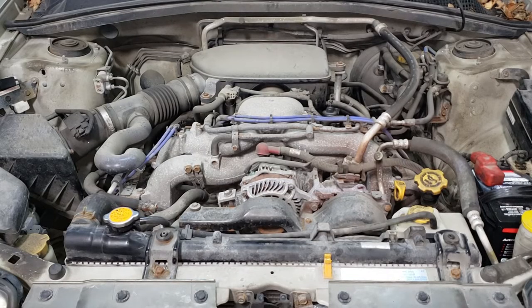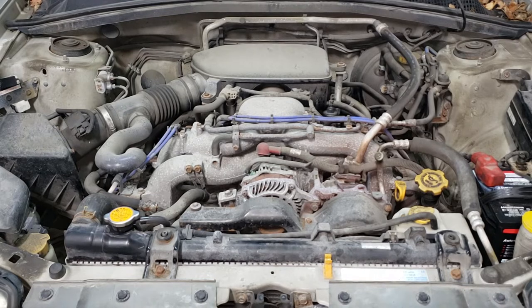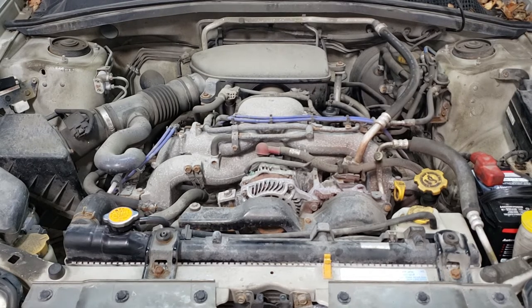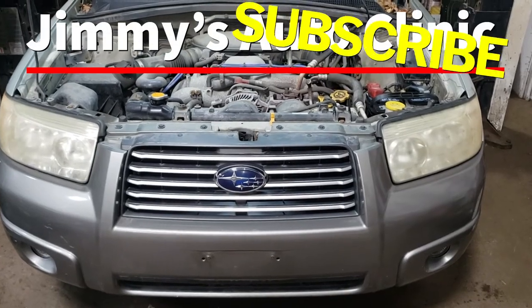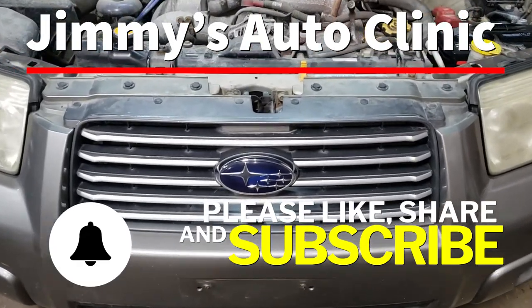The only thing left to do is take your vehicle for a drive. Make sure you clear the trouble codes first. Take it for a drive that is at least five kilometers or more in length. Make sure the vehicle comes up to operating temperature — meaning the thermostat fully opens — and make sure the vehicle is cold when you first start your test drive so the vehicle makes a complete run cycle. Generally if there are any issues they will arise in the first two to three cycles, so keep an eye on the car. If there are any drivability issues bring the car back and figure it out. I'm pretty sure I solved the EGR issue and likely the fuel trim code as well — though that could also be related to the O2 sensor code. Time will tell. If you liked the video please like, share, and subscribe, and hit the notification bell so you never miss a new video.